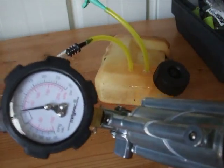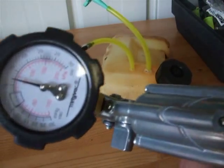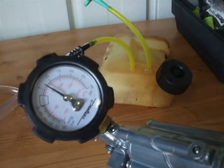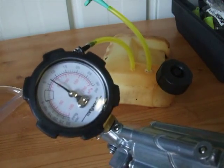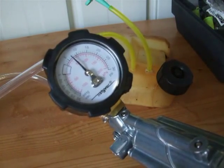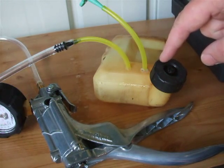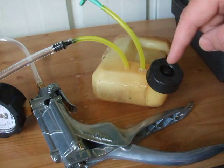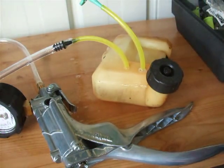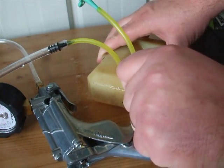We are building up a bit of pressure now. You only need to pressure test these up to 7 PSI. That's at about 7 - it's pumped up and it's holding at 7 PSI. The second test while that's up is you can turn the cap half to three quarters of a turn - so that's a pass basically for the tank. The next thing is to test the cap: it should release between half a turn and three quarters of a turn. If it does, it's classed as the right cap. You should be able to hear the pressure release.